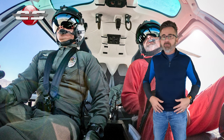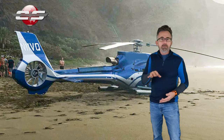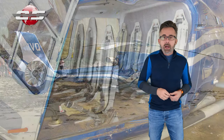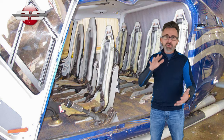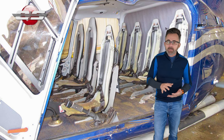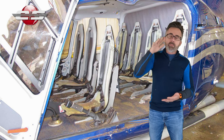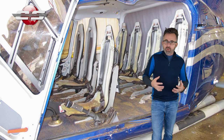What happens in an accident if you're loose in the seat: if there is a rapid descent, you'll get light in the seat and then slam down onto it. Since you're loose, it really never allows the seat to collapse correctly. Or if you just have a hard landing, you hit and then bounce up and come back down again, not allowing the seat to do its proper job.